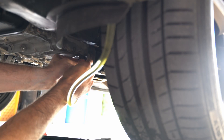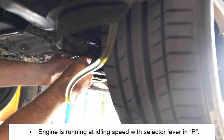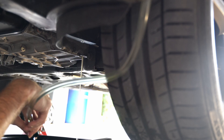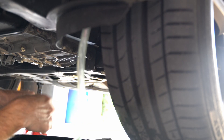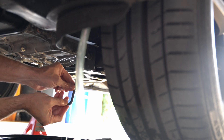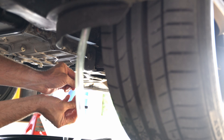So I'm unscrewing the hose now and letting all that excess oil drain into the collection bucket. Then — unfortunately my hose landed in exactly the wrong spot in the camera view — I am backing out that overflow tube by two turns. You can see it with the Allen wrench there — two turns.